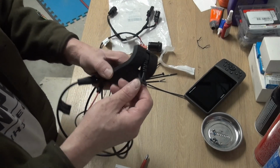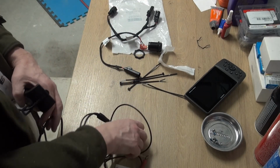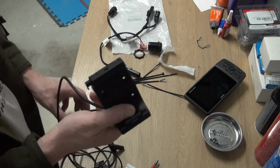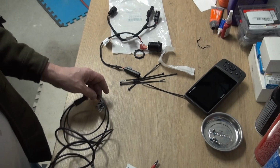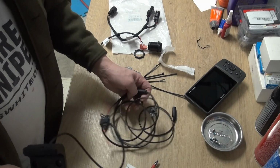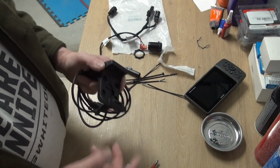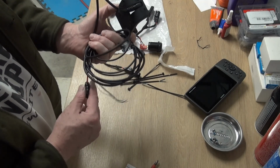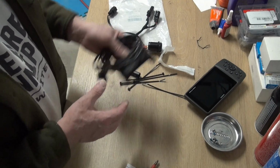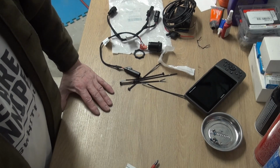But I don't want to put a big hole that's going to have to take all this, like the fuse and this. And if the system's already fused, I'm not sure if I need the 2 amp fuse on it. I'll see what the fuse on the accessory circuit is. Because if it's like a 5 or a 10 amp fuse, it's a 10 amp fuse. Probably might want to still keep a 2 amp one on here so it doesn't drive too much power to it. But I think we'll consult the guide and the manuals and we'll take it from there.